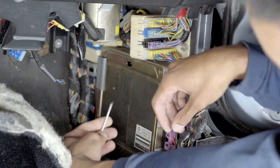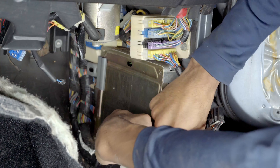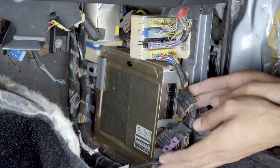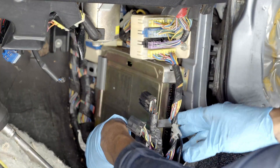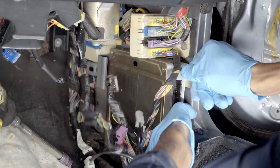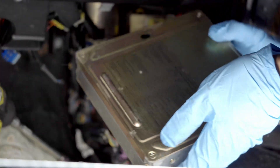So there you go — that thing was broken. Now that's out of the way, I should be able to press this down and pull it out. Now that we've got this out, there should just be a couple of screws to pull out the ECU. And that is the stock ECU out.